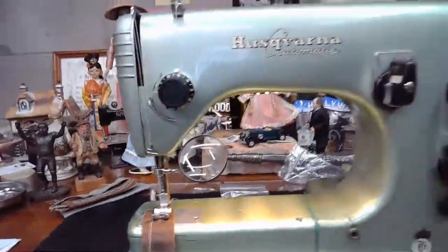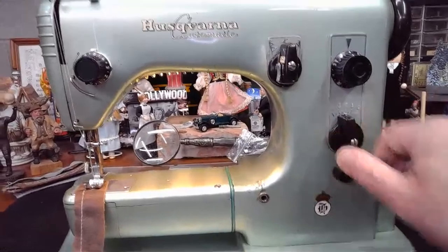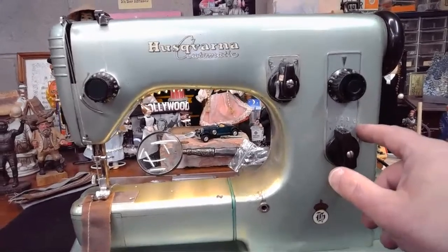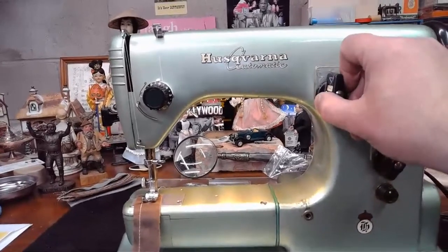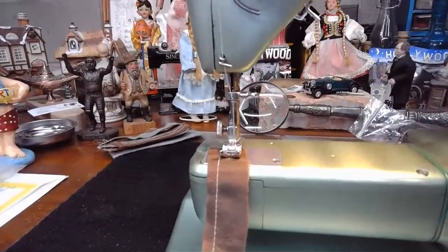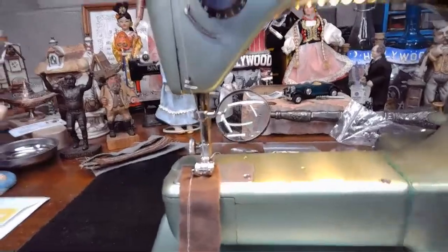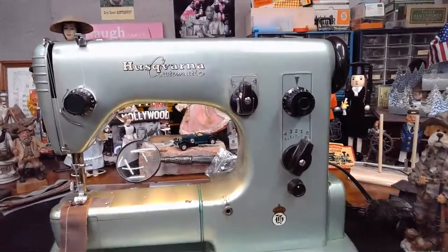Because when I turn this, nothing's happening. And I said, well, where's your stitch width right now? Where's your stitch width set? And they said, I think they said it was on three. I said, take your stitch width and bring it all the way down to zero. Now try your needle position. See that? Needless to say, that customer never went back to that sewing vac again.